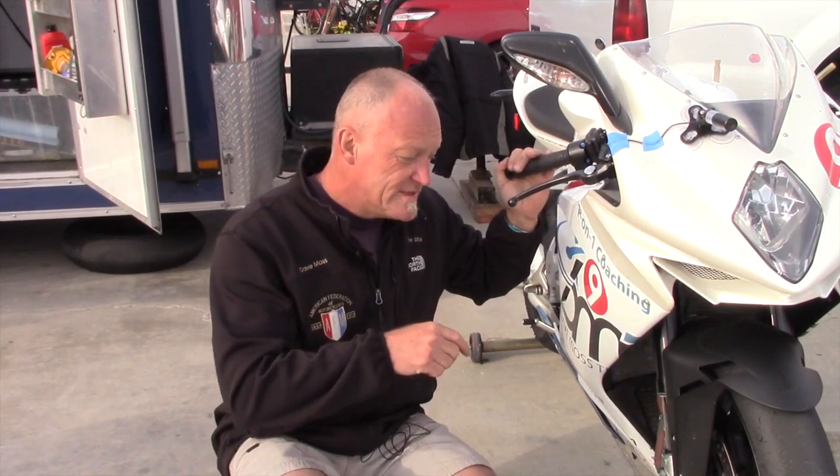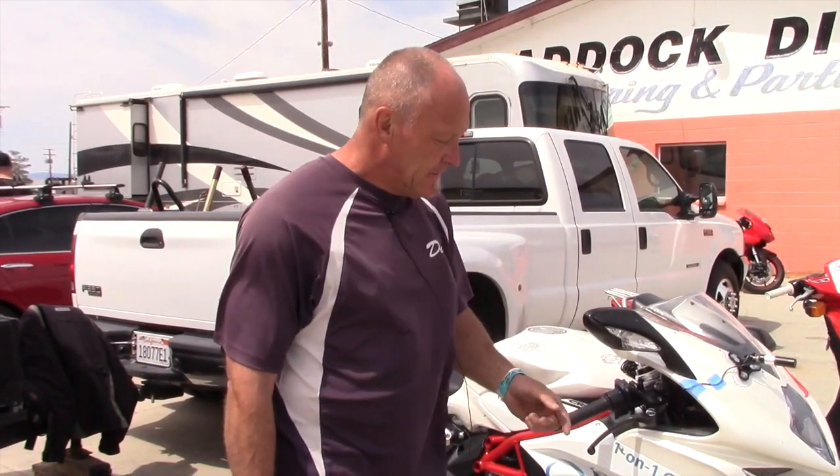As we continue to ride today, especially with Alex this afternoon, we're going to go faster. We have to do something about making sure that in the corner - not on the brakes - that bottoming out is avoided so we don't low-side. Given that we bottomed out here on the G-out with Alex yesterday running a 1:45 down to a 1:38, and going faster generally, the forks are bottomed out.